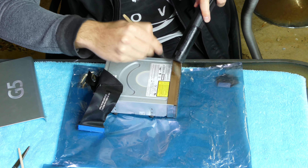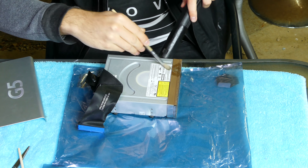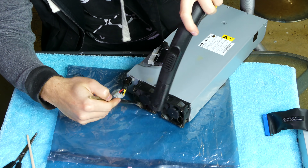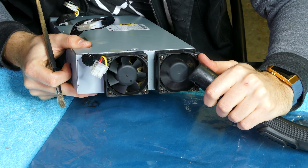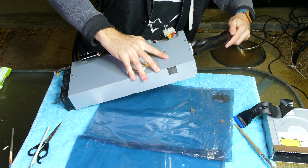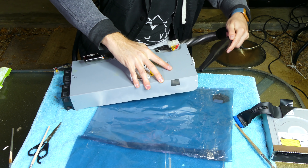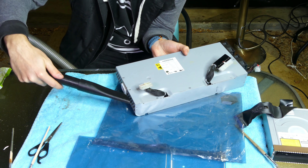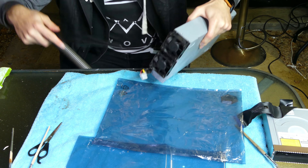The optical drive wasn't overly dusty, but the metal had pretty serious pitting and the front bracket had a lot of rust on it. I started off by dusting the power supply as much as I could, even spinning up the fans using the vacuum cleaner. The real fun began when I used high-pressure air to remove all the dust within — oh boy was there a lot of dust. While I could definitely have opened up the power supply, I feel this method got rid of most of the dust at the very least.